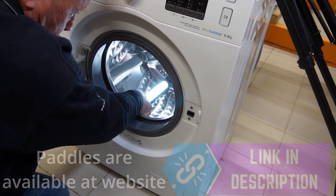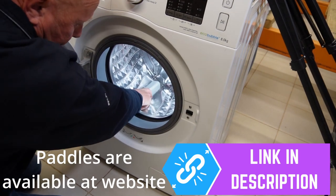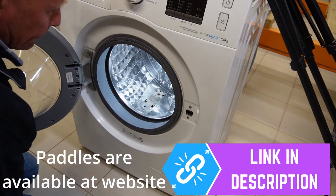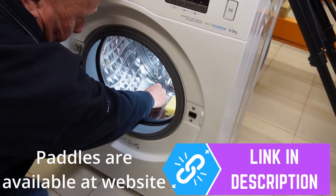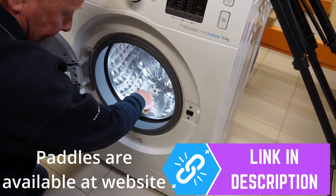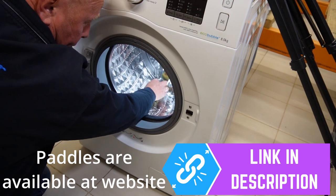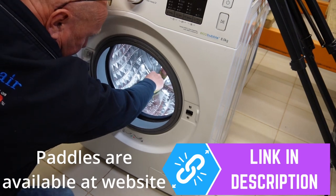I'll put a light in there so you can actually see. Here is the drum paddle, and what you need to do now is slide the paddle forward. Once the paddle slides forward, it will come out. Now we can clean up this surface quickly and then replace it with a new paddle. You can actually see the amount of dirt — and the person who owned this machine had pets because you can see hair there. Be careful when cleaning up this area because there are sharp edges, so just go over it with a scourer. This shows you how much muck actually appears in washing machines. If you watch my video on how to remove mould on a washing machine, it'll show you how to clean the drums — I'll put a link to that below in the description.